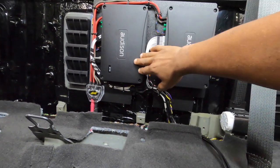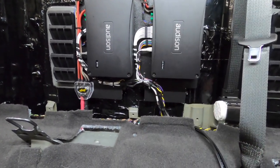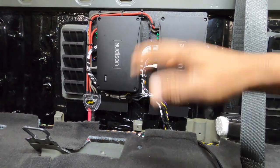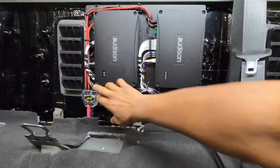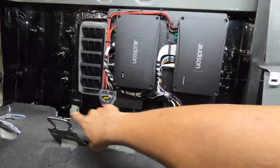It can run at 1 ohm — I prefer to run it at 2 ohms — but in this case the customer bought JL woofers, which we don't generally use, so we're going to run those at 4 ohms, boost it, and tune it based on what we have. We use a Stinger distribution block, and we ran all four-gauge wire to the back because these two amplifiers are the previous generation with 8-gauge inputs.